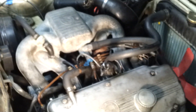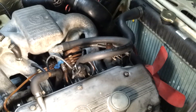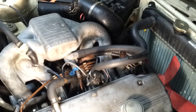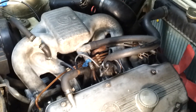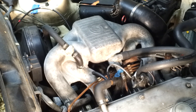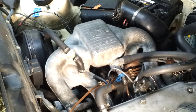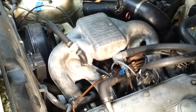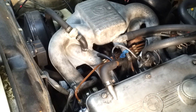That's it — it's pretty easy to do, and it's a great way to get your car running better and help you pass smog. If your mixture is too rich, you might be having some problems. A lot of people in California have problems getting these cars to pass smog, and it could be something as simple as the mixture. For idle, somewhere in the 900 to 1200 RPM range is pretty good. For manuals, I think it's a little higher, maybe around 1100 to 1200. If anyone has a definitive number on that, go ahead and post it in the comments below. If you have any questions, post them in the comments below and I will try to get to them. Thanks for watching, guys. Bye.